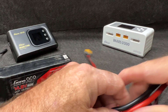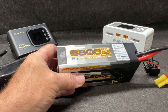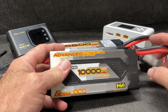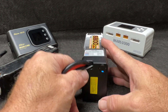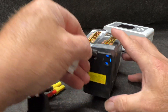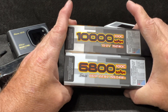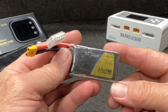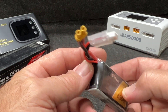These are the ones I just recently got — the new 6800 milliamp smart G-Tech batteries right here. I've had the 10,000 milliamp 4S batteries for quite a while; you've seen those in the Raminator, the Ram Balancer, all kinds of vehicles — proven to be really nice batteries. They all have the little indicator right here so you can see the state of charge. This one's a 6S and that one's a 4S — the same exact size, but six cells versus four. I use them all the way down to the 650 and even some 450s in my crawlers with little XT30s.